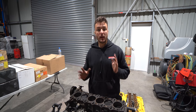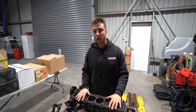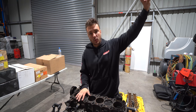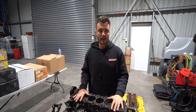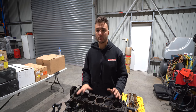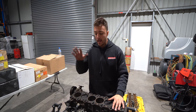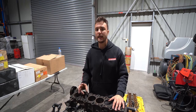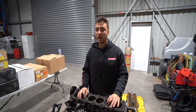Now, I'll just touch on a subject. This might be a rumor, I might be wrong, I might be right, comment below: when you don't have the oil squirters, the oil doesn't actually tee off to the squirter that goes under the piston. It goes directly to the main bearings and you end up having high oil pressure. Let me know if I'm wrong, but I'm pretty sure I'm correct. Yeah, some people like that for high horsepower builds as well. And lastly, the pistons are made of the same cast or the same material, but they are a higher compression.